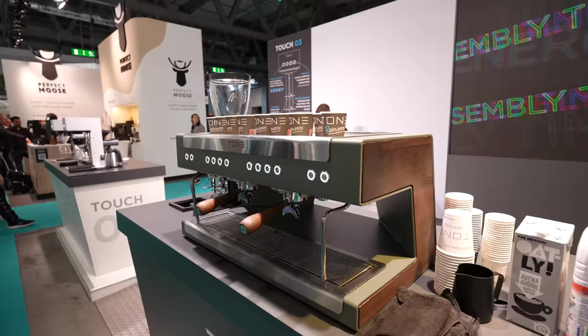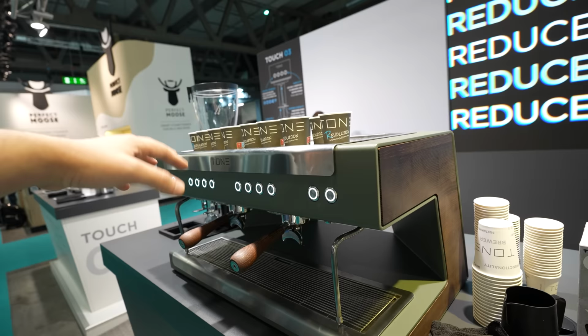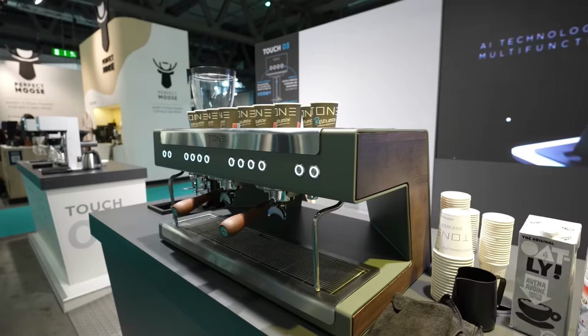We have their new espresso machine. It's boilerless, instant heating. And interesting stuff, they will be able to brew espresso with cold water and hot water. And those are the steam ones. Here you get hot water. So basically it's very energy efficient. You don't have to keep heating the water inside of it, good for coffee shops with high electricity bills.